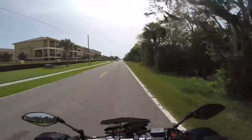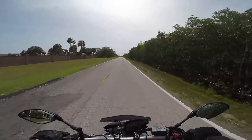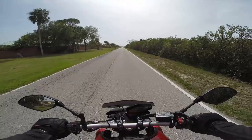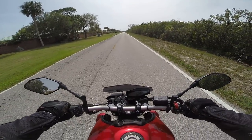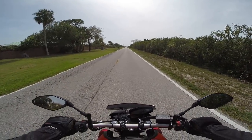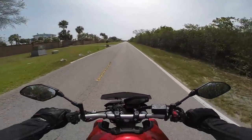Nobody behind me — let's start testing the brakes. This is just front brake. I did front and rear last time, so that'll be a fair comparison. Just a normal emergency stop from 40 miles an hour. Okay — dramatically different. Huge day and night difference. That was actuating the front ABS and pulsating the front end, just like the rear. Everybody should do this. That is a totally different braking experience. Completely different. Do it again.